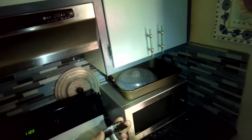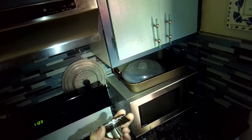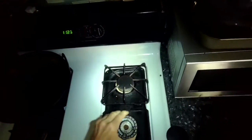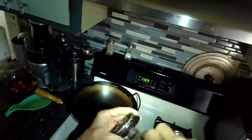You can also take a wire brush and really clean the igniter — be gentle on the white porcelain igniter, but get it nice and clean. Then scrub the metal parts: the burner head and the burner cap, the piece that goes on top. Scrub it really well with your wire brush so it's nice and shiny.